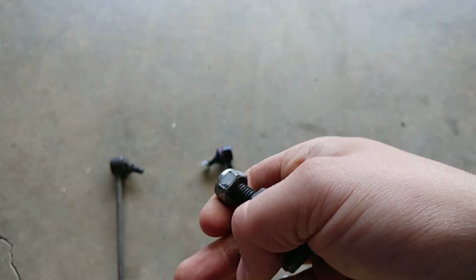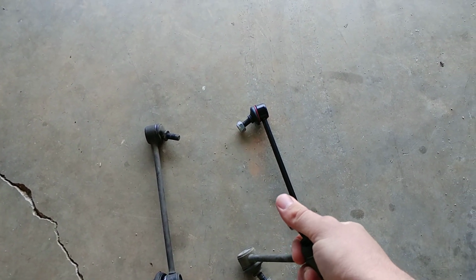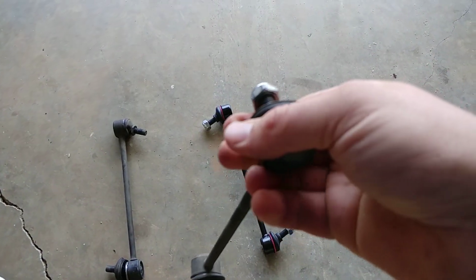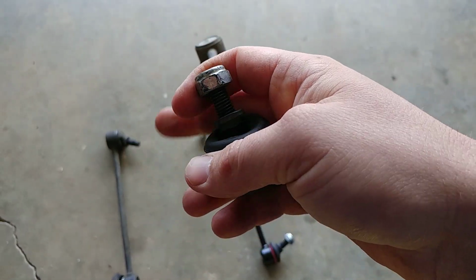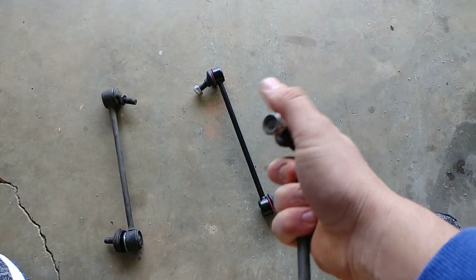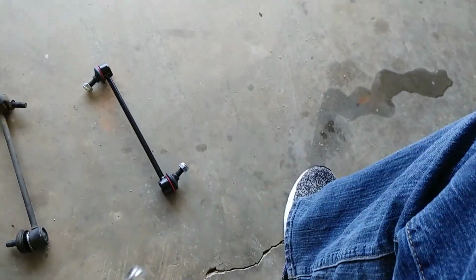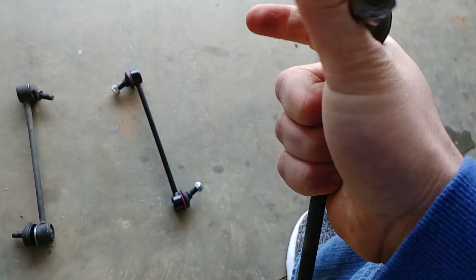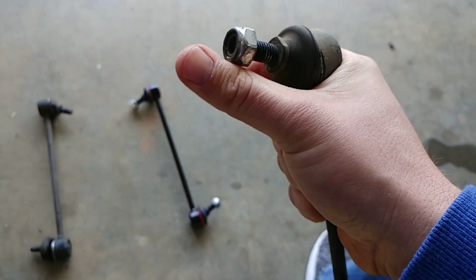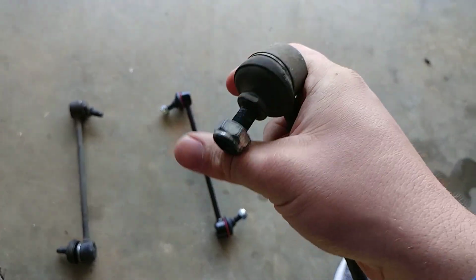This sway bar end link had locked one of the ends up, and it was popping, and it was using the sway bar almost like an instrument to massively amplify the sound. Now this side was okay. I can kind of move it a little bit with one hand. This one's pretty loose, which is normal as they wear a little bit. That wasn't the issue. Ones that are really loose, when they start slapping around, they just literally can't hold themselves up. They're just toasted.